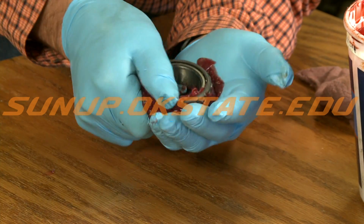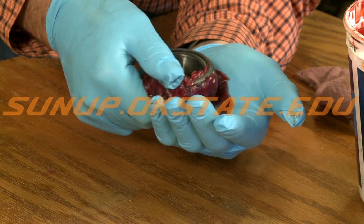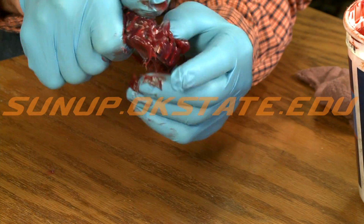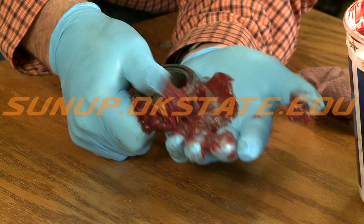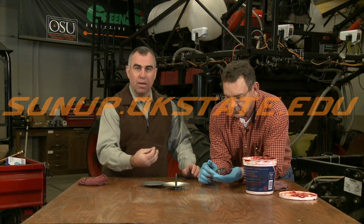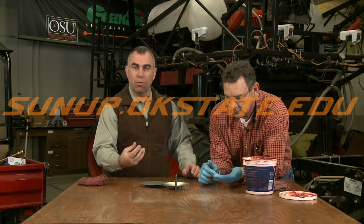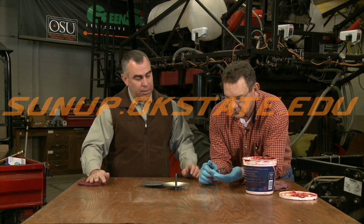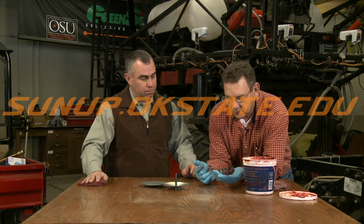And you can see that grease is coming out the top like Randy explained earlier. So essentially, we're greasing all sides of the rollers inside the bearing so that when you put it in and you start to roll it inside that axle or whatever it might be, it is completely greased. So go all the way around, push it through, and that's how to pack a bearing.